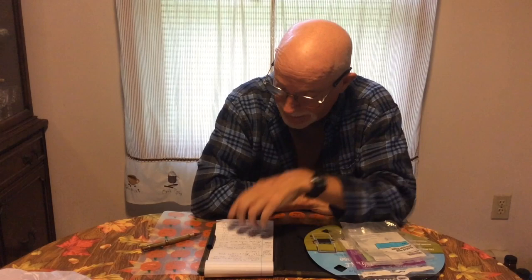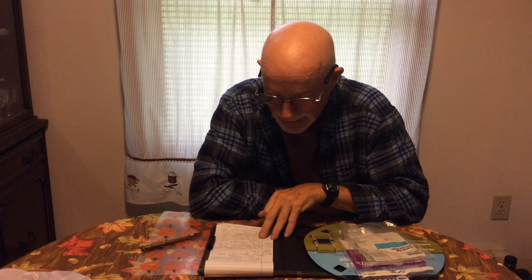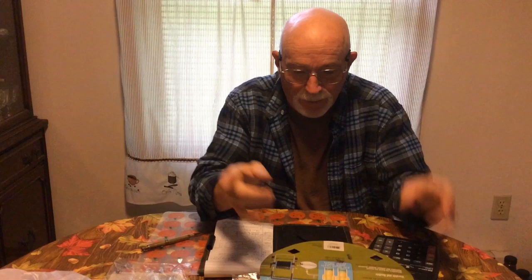I was just dropping it into a bucket and the bucket tracked bugs and stuff. So over the summer I put this thing together pretty quick and that's how I ended up the way I did. My total cost was $58.00, and now I've added $15-something to that. I don't think you can buy a gray water tank for that price. The parts that worked well: the bulkhead union at $13.76 — it's called a bulkhead union — a couple of adapters and the brass caps, I'd buy them again. This sink fitting I wouldn't do again. The hose I bought at $7.97 was way too expensive for what I did.